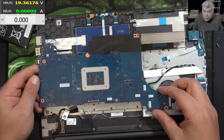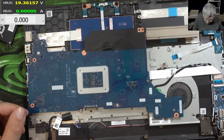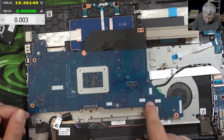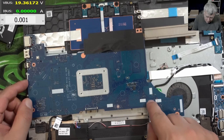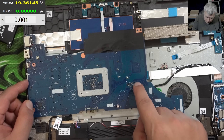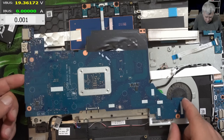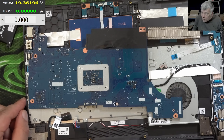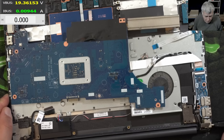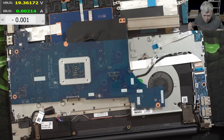It's pretty clean — I can't see any liquid damage. You can clearly see the charging port track — it's a big track. This is the input, you have the first MOSFET, the second MOSFET, the current sensor, then you have the main power inductor. Plugging the charger — of course it's not taking power because it's disconnected, but let's check the voltage.